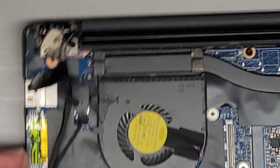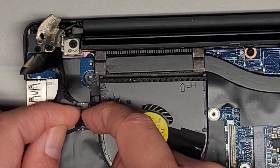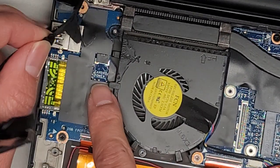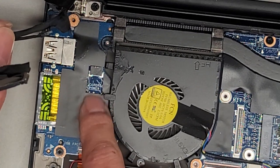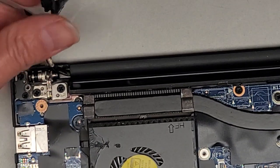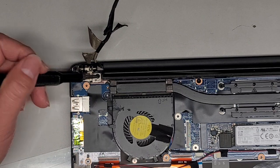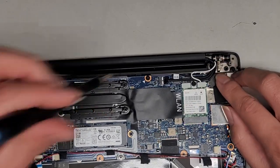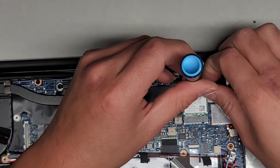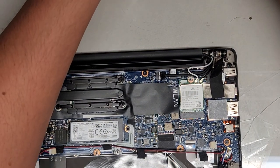Now we have this cable, and we also have to disconnect this part here. I use my fingernails at the little edge of the plastic part of the connector and wiggle it as I pull. This one says 'card reader power' — so I guess the card reader gets power from here. We'll push that cable out of the way. We've got these two screws to take out, so let's go ahead and get the wireless card out. This is actually JIS1, but I used the JIS0 and it worked — but be careful the screwdriver isn't skipping.